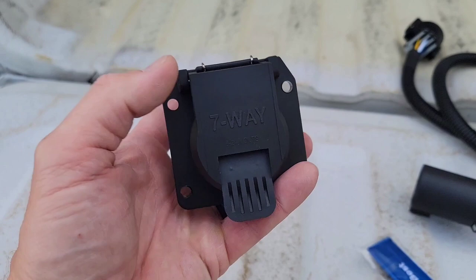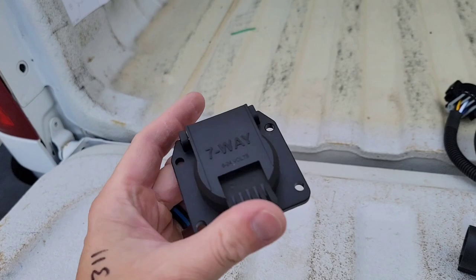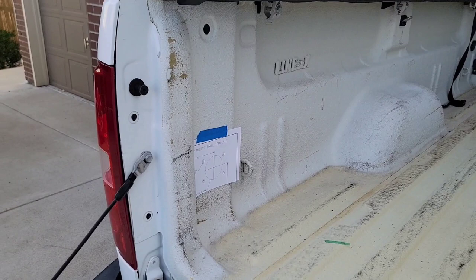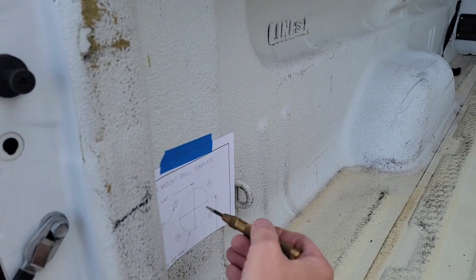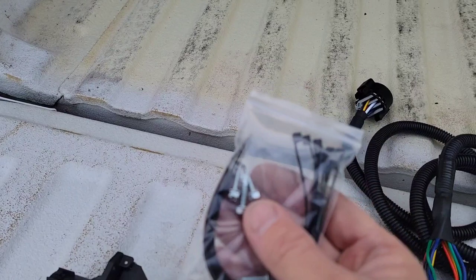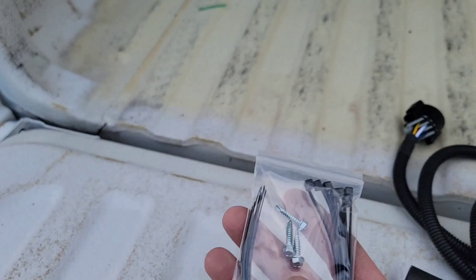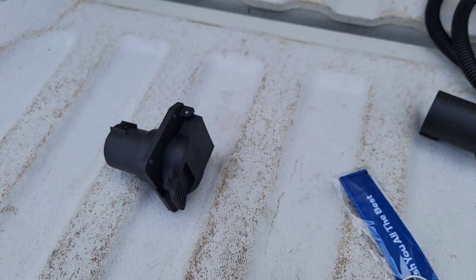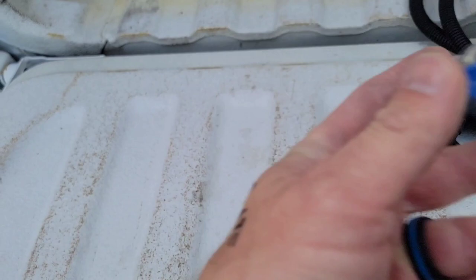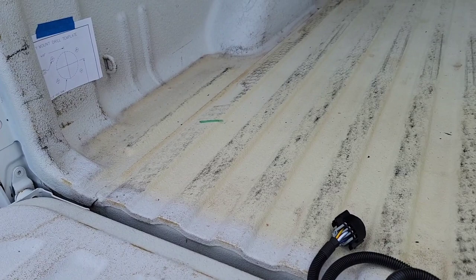There's the 7-pin. I see really no difference from the one that I bought from Ford or Curt in the past. They don't put any dielectric grease on there, which they do on the Chevy stuff — so we might put some on there. I'll put a link in the description of all the tools we need. So I cut that template out. I got my little striker here that's going to tell us where to drill. We're going to drill a pilot hole here. If you've never used one of those, basically that puts a dimple point in there — it makes it easier to start your bit. This one doesn't have the little screw-in metal flanges that clip on like the Ford. This one's actually a self-tapping metal screw. Keep in mind when we torque it down, not to over-torque it and snap that plastic off because then it will be completely useless.